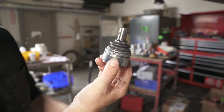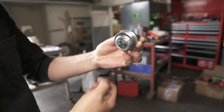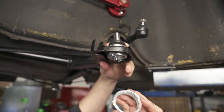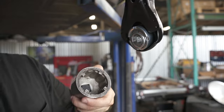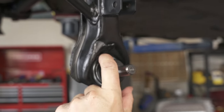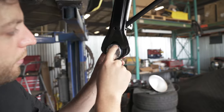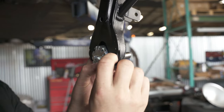Now we're going to install the decambered ball joints. Come to the bottom, pull out the cotter pin and remove the locking plate, then unscrew the collar on the bottom and drop the ball joint in from the top. Line this notch up with the key, then push the unit up and install the collar on the bottom — you want the notches facing down. We've got our special tool that has the same notches as the ball joint, so we line that up and tighten it. Be careful not to over-tighten — you can bend the tab or break it off. Torque spec for this ball joint is 184 foot-pounds. Now put the locking plate on the bottom, line up the rectangular cutout so one of the fingers lines up with a tab, push it in to stop it from rotating, then install the cotter pin to hold the plate on.